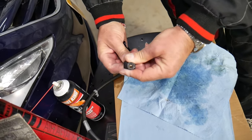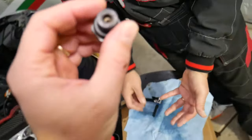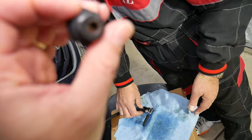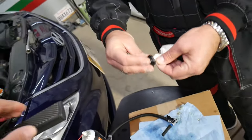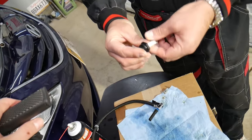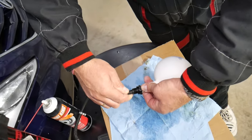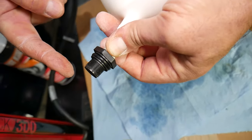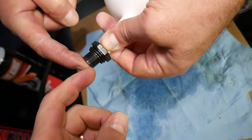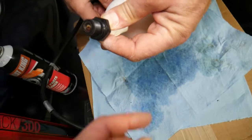It's still not closing all the way. It's still not closing — this valve has definitely failed. We'll test it with the balloon again. It's way better, but it's still leaking, so cleaning will not fix it. It's not sealing correctly on the inside, and it shouldn't be that way — that's a bad valve right there.